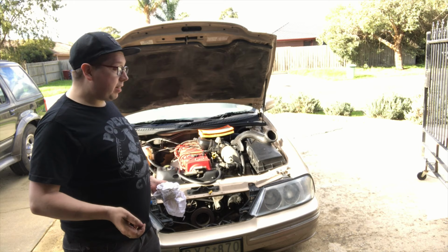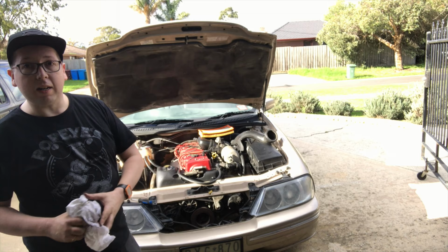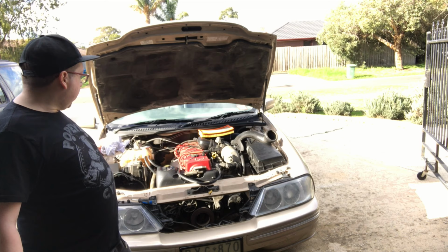Next, you need to remove the fans off the front. Out they come. Then you make sure you remove your transmission lines out of the radiator. Now I think there are 17 on the side. You take both of those off. You take the top radiator, the bottom radiator, and the radiator fill off.